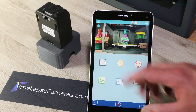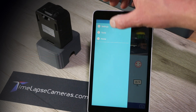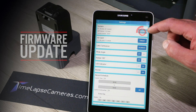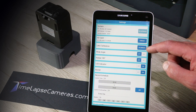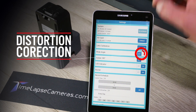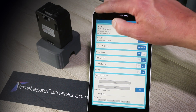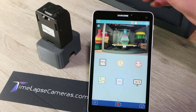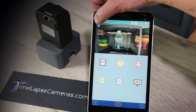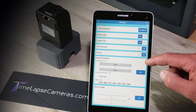Those are the two main app screen pages. There is also a flyout menu with settings, tools, and back to home. In the settings, if we had a firmware upgrade it would let us know here. We can format the card here. If our camera wasn't focusing and the autofocus wasn't working, we could calibrate it here. Wide angle allows us to take out any bowed corners and straighten up the image. Rotate 180 is handy if we want to mount the camera upside down — it will rotate and record the video in the proper orientation. LED indicator on or off, buzzer on or off — we leave those on all the time.